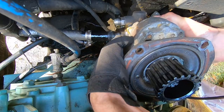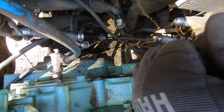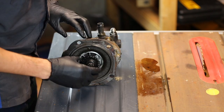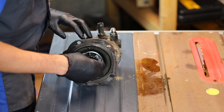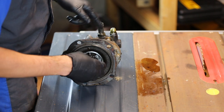We're going to pull it off of this hose — there we go. It is now time to take this pump apart to figure out what's wrong with it. The pump is driven by this gear, and it spins pretty freely, so that's a good sign. It still functions — you can kind of see it shooting oil out there. There's no play in the shaft, also a good sign.